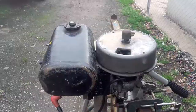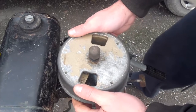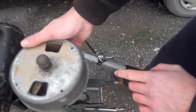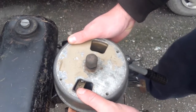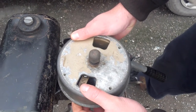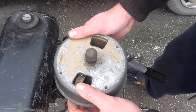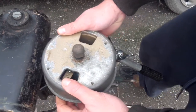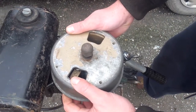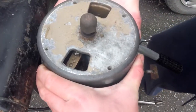So we just drop it down now. From here we line up our pencil marks — just there again on the front — making sure that's perfectly straight. You get your assistant then with a lump hammer. You could use a normal hammer, but I prefer a lump hammer as it delivers a better, more solid blow. It does have to be quite a sharp blow — small ones won't do any good, won't release it, and can actually damage the crank as well. So you lift the engine clear off the ground and then hit it one blow.